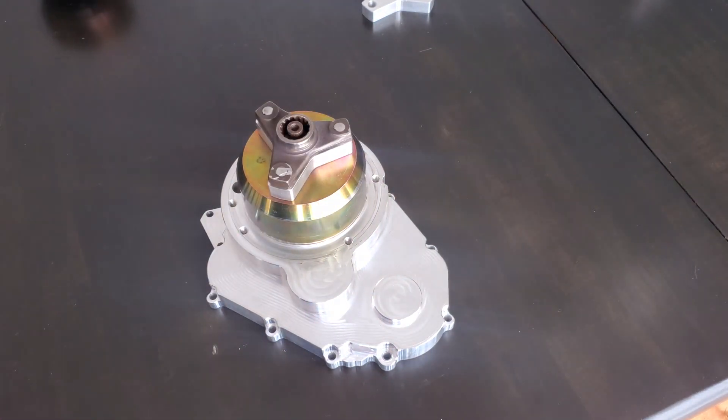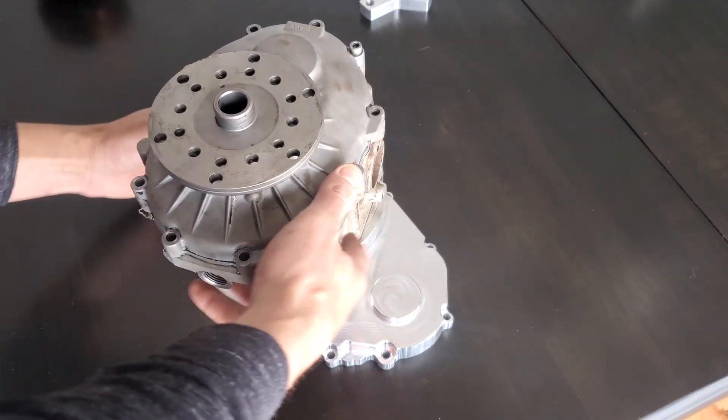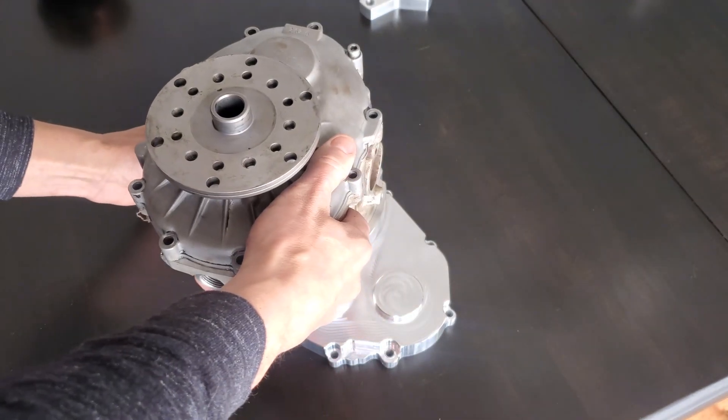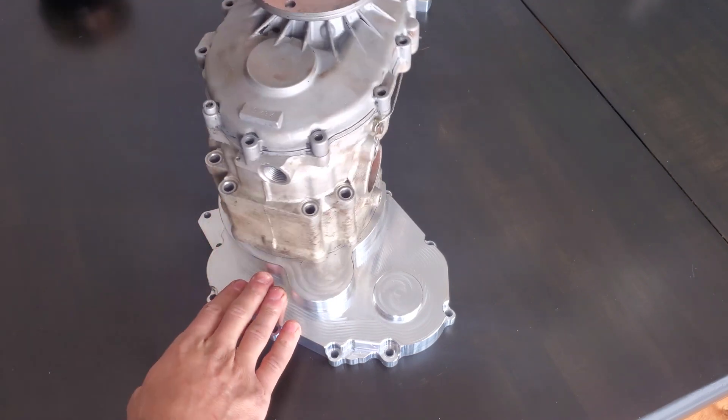This is like the stock setup on the RK400 clutch. See how this is the C-Box spline adapter thing that goes on the clutch bell? Remember I had to cut down my C-Box to make everything line up right because the length wasn't right. So there's the solution — very simple, no big deal. It's just a little billet adapter that is self-centering, and what that does is it just pushes the bell housing out to engage the clutch where it needs to be. I wanted to make this a full bolt-on solution without any machine work required. You get the parts and you have everything you need to put your C-Box on.